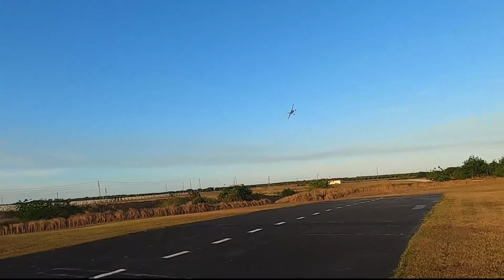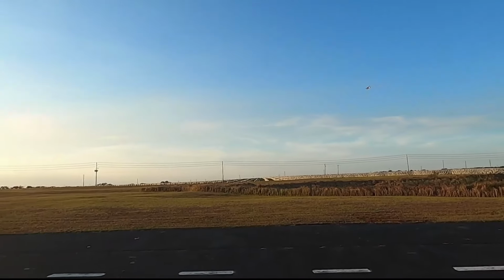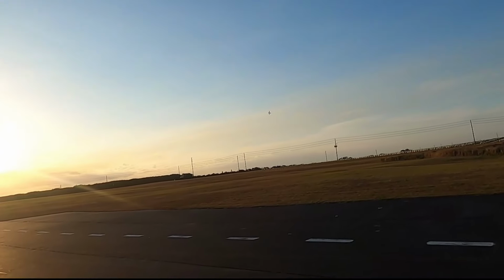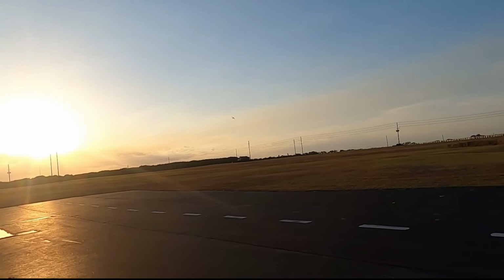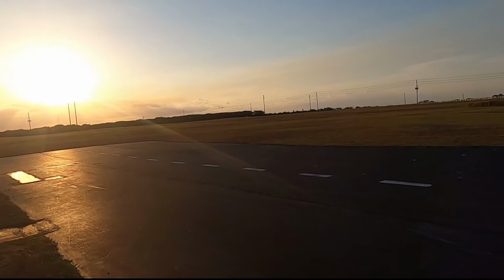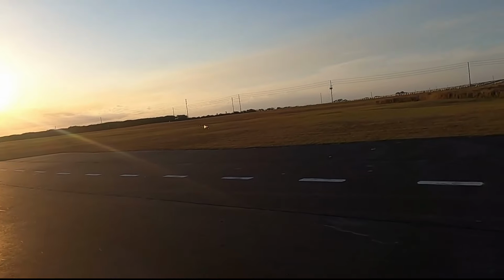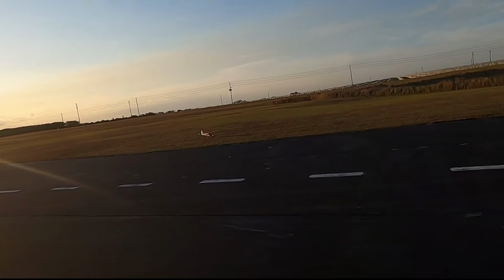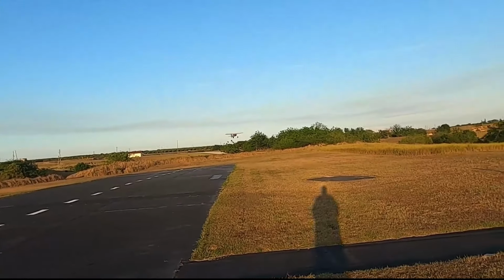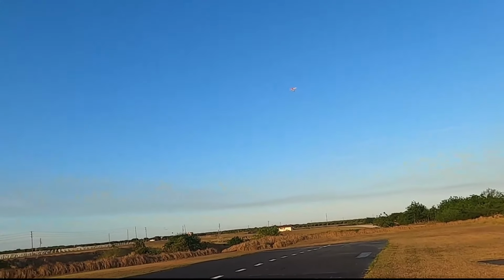So far, Bigfoot has more power, okay? But to be fair, the vortex generators on this one are very pronounced, they're much larger, and so they really grab the air, so they create a lot of drag. But they're meant for slow flight. They're walking the dog a little bit. They're meant for slow flight stability. That's the point of them.